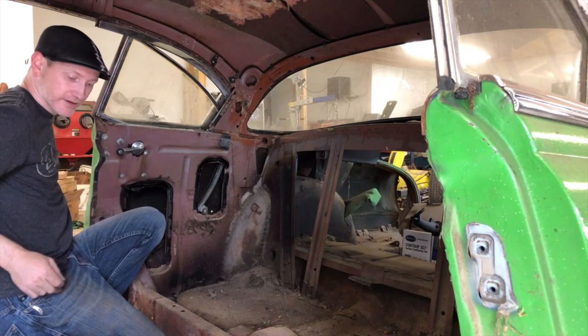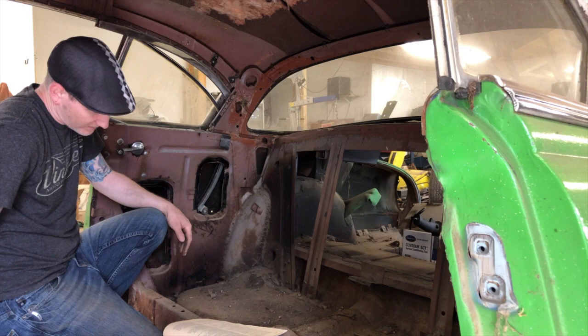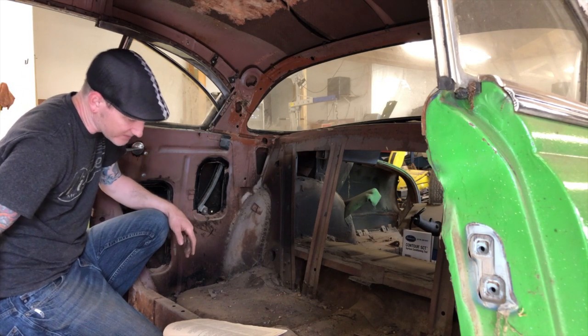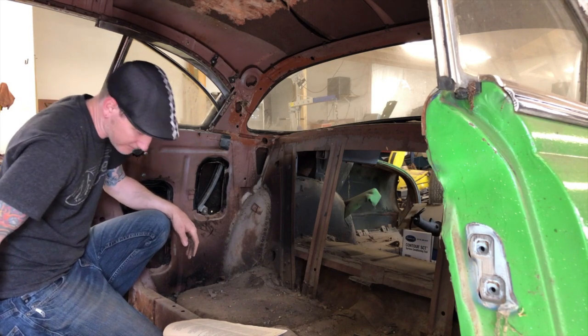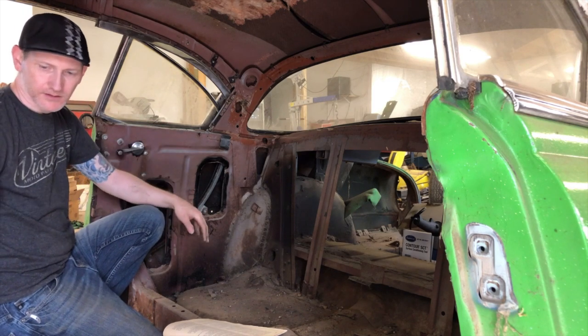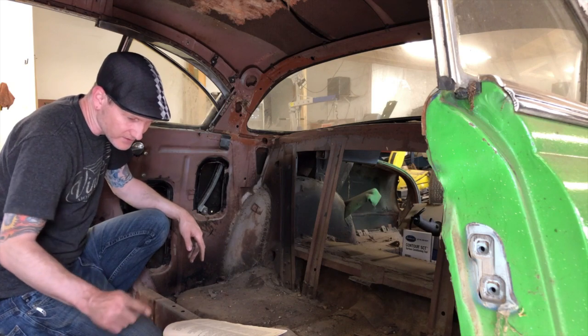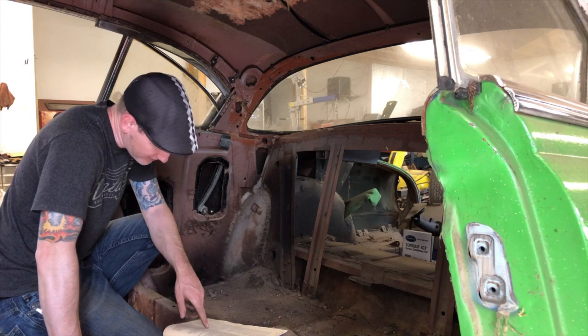So I have the manual here. I'm gonna kind of follow the manual. Hopefully it'll walk me through it. Okay, if it's a convertible, lower the top. Done. Remove the rear seat. Done. Remove the quarter trim and hardware. Done. Remove molding support. Probably pieces of wood. No, probably not, because in the picture it still has the piece of wood there. I don't know. Remove quarter glass hinge pivot bolt.